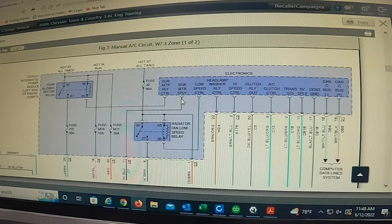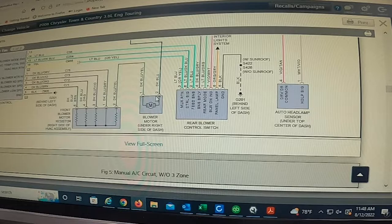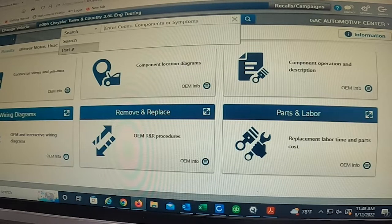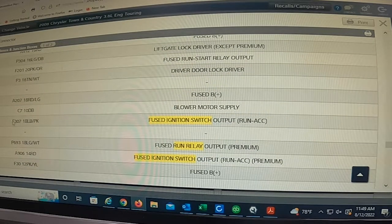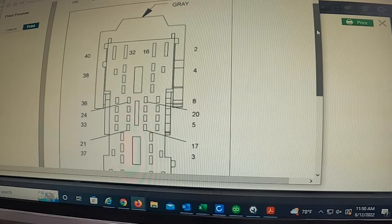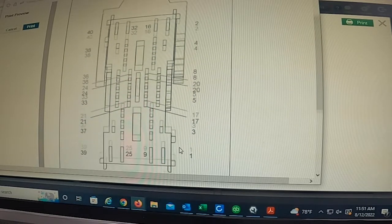What I'm going to do is try to find this pin location and ohm out the wire from here all the way down to the blower motor. If it ohms out correctly, then we know we have a bad fuse box. We're going to type in TIPM — T-I-P-M — and go to component connector. It was the C connector, so this is connector C. Scrolling down, right here: blower motor supply, number 11. So we need to find pin 11 on the gray connector — counting it out, this is probably pin 11 right here.